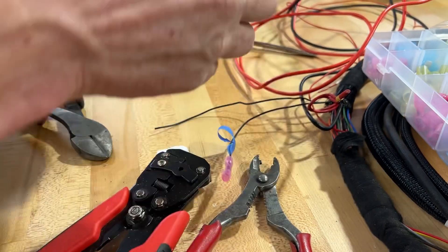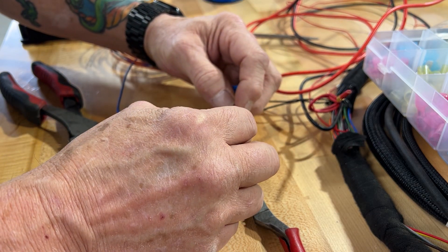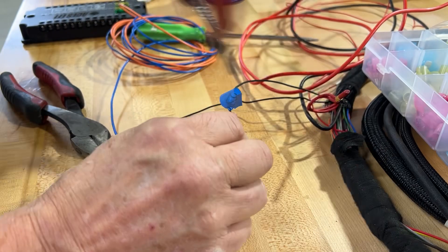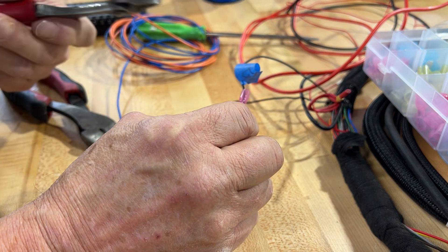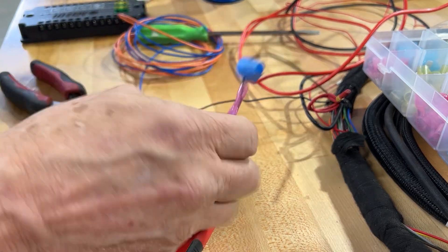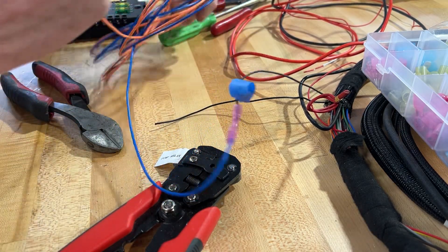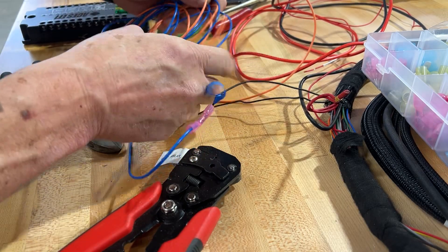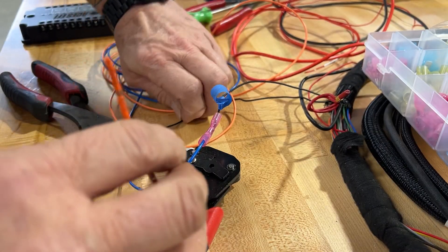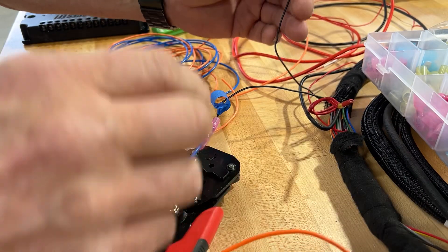That's connected. I'm going to use a blue wire so I know this blue wire is my MRD wire. Now, because of where I'm going to put my PDM and where my ECU is going to be, I'm going to need wire to go longer than what I could use. This orange wire that I took out — you could just connect the other end of that, and then this wire would become your trigger wire for your pump.